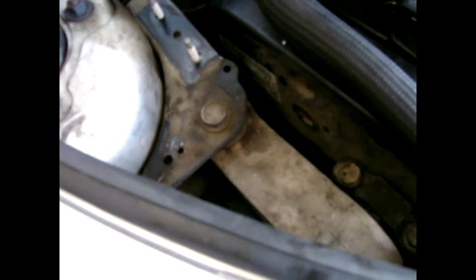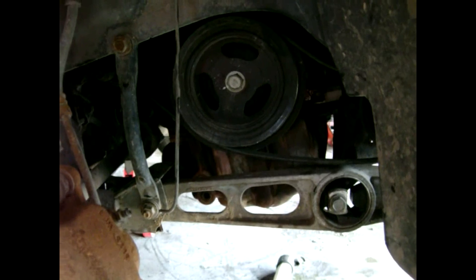I'm going to take this whole front mount off here and also the power steering pump, because that is connected to the bracket that's going to need to slide out of the way to get that cover out. I'm going to need to prop the motor up with a jack, and I also need to remove this lower engine torque arm. The project's moving along — just go step by step.